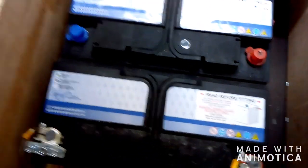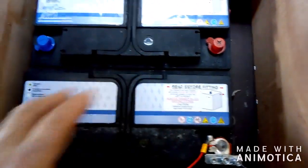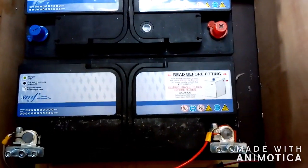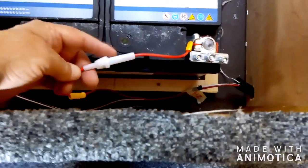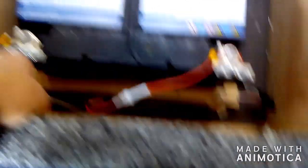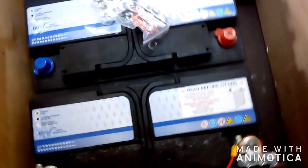There's a lot of confusion about whether you need to fuse between the batteries — in this case they're so close there's practically no chance of a short, so I don't think it's necessary, though I might do it in the future. At the moment this goes to the ZIG unit — that's a 35-amp fuse. I'll be using 8mm cable to 8mm cable and then the earth down through the floor.